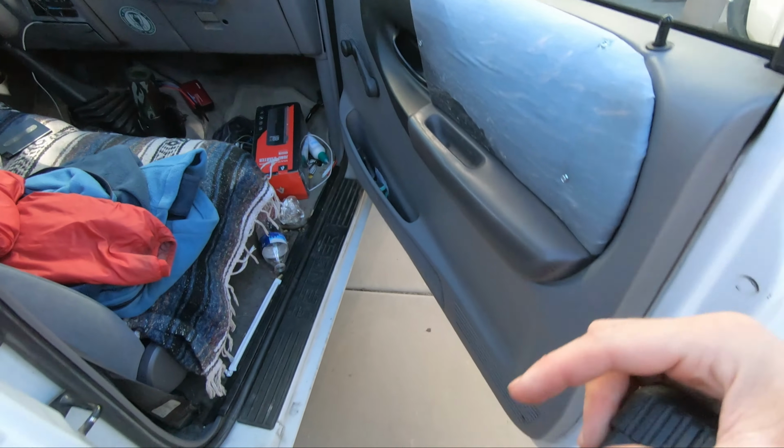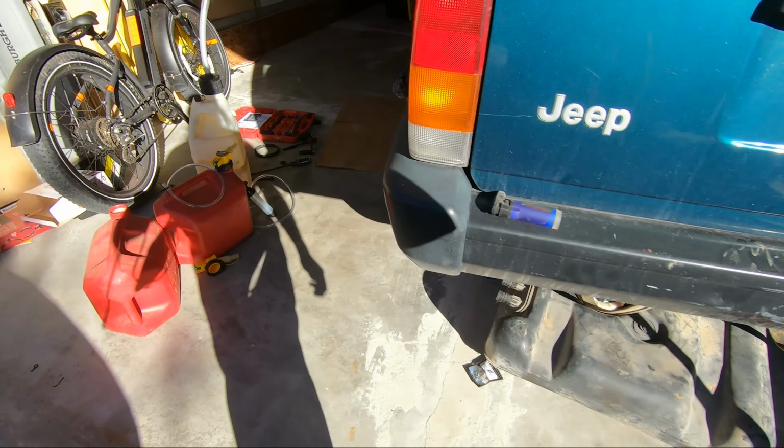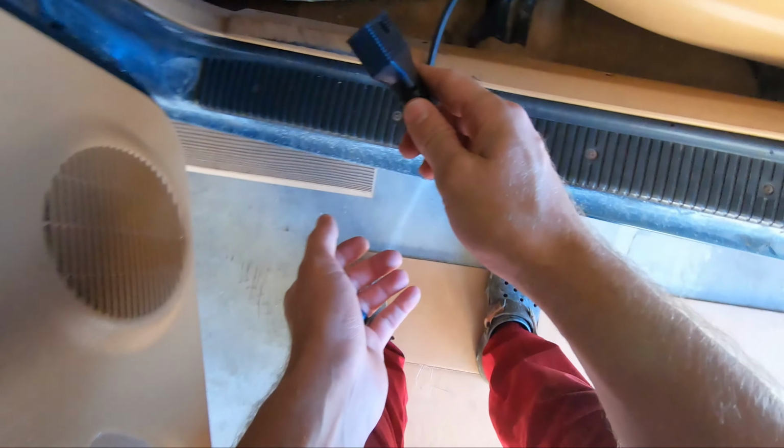Okay, I double checked the year. That's great that it's OBD2. So I can turn that fuel pump on with the bi-directional tool, and then I'll be able to test for power at the relay. Start from there. Something you wouldn't be able to do with just a test light, which the vehicle owner has.